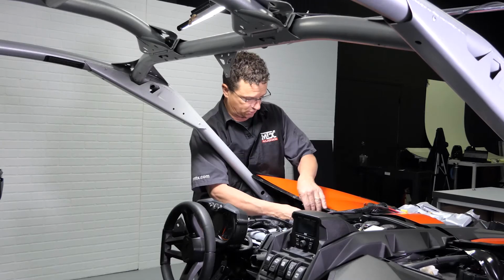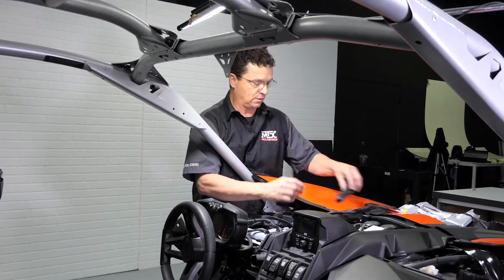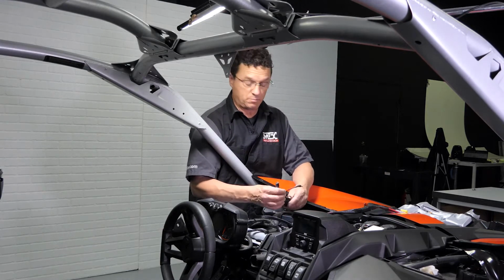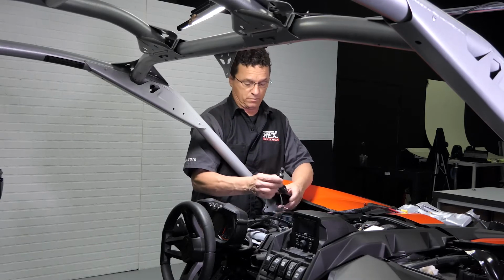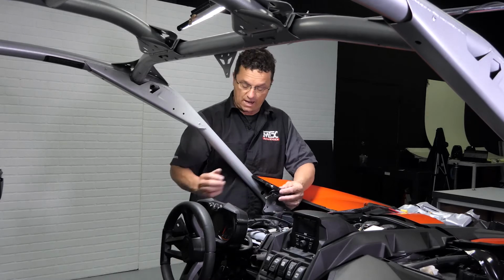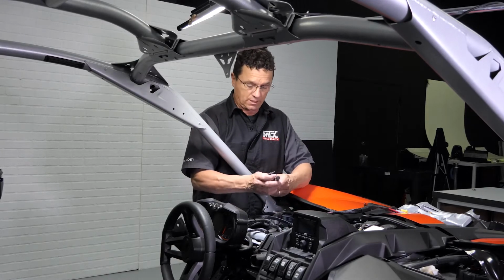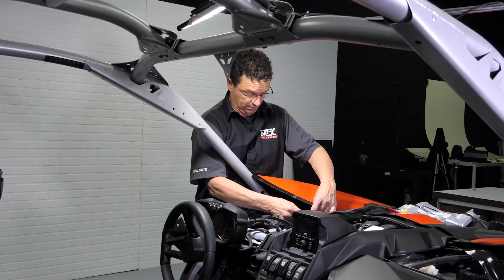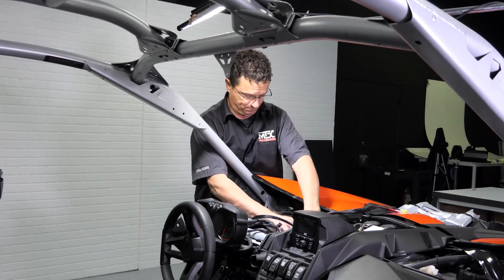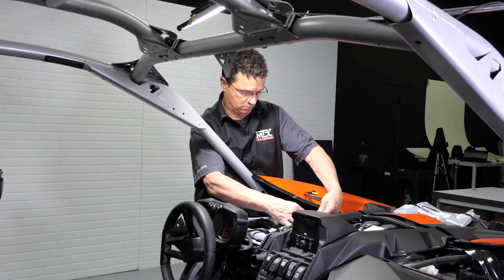And then you'll notice you have one 3.5 millimeter plug left over. That's for the external bass control that would have come in the 600's box with it. Now this is going to come with a bunch of different mounting options. We have chosen to put this in the dashboard in one of the knockouts that we aren't using. So for right now, we just want to plug this in and leave it in here until we put the upper in. Okay, so everything is plugged in other than power and ground, which we'll do right now.